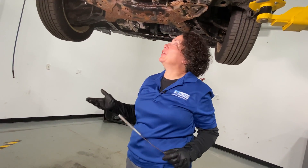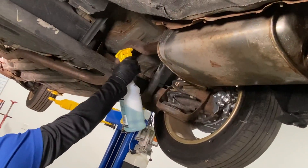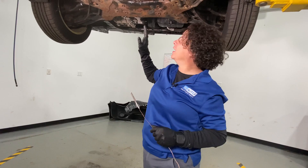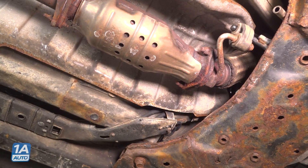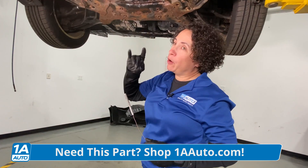We found it, and it was fun! It never gets old using the spray bottle — I get excited because I genuinely didn't know exactly where the leak was. I knew it was in the mesh area but didn't know how bad or where specifically; it could have been up at the top. The good news is this pipe is very easy to replace. On this particular car, it's a matter of four nuts.